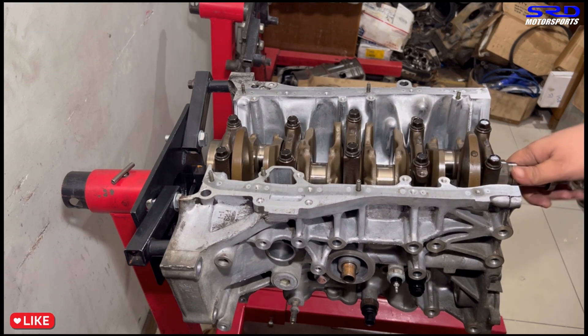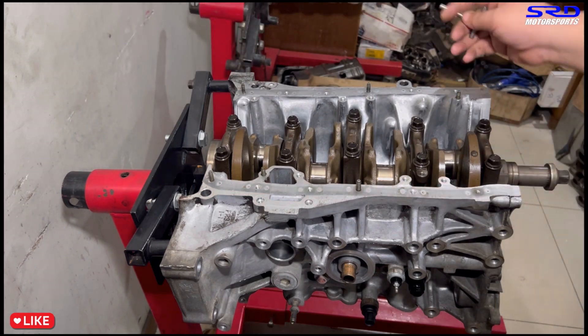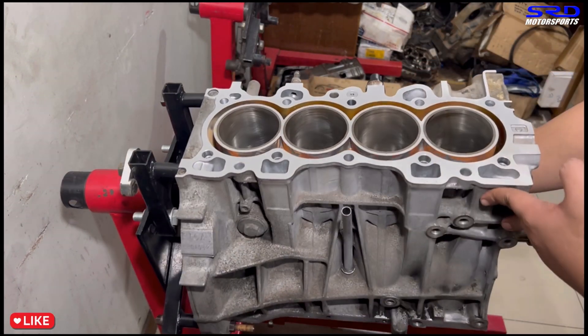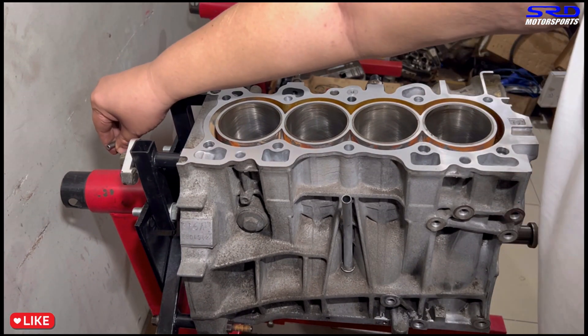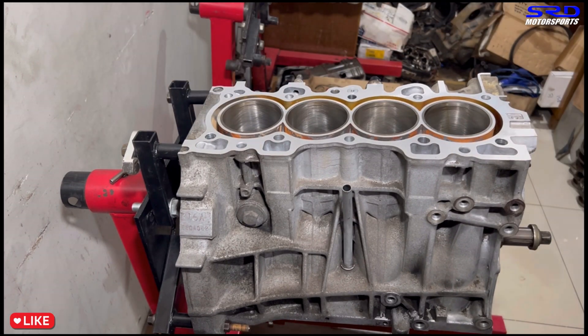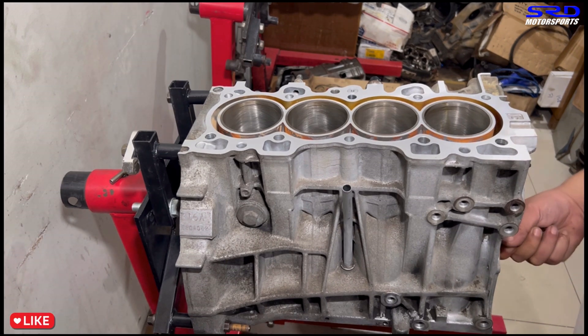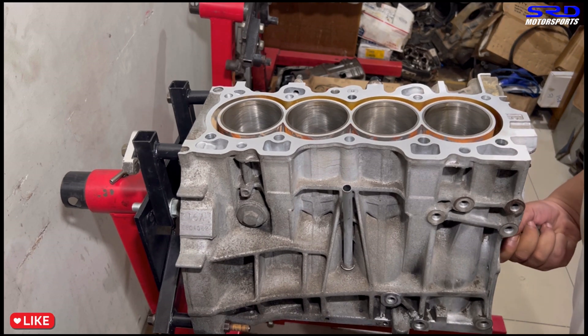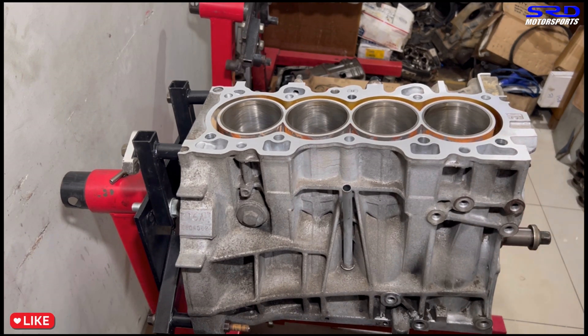It still spins light because the crank is in really good condition — same as when we disassembled it. We turn the block over so the assembly lube doesn't drip onto the bores, as Jay Meager of Real Street Performance suggested. We need to wipe the bores before installing the pistons. As soon as the rods and pistons return from the machine shop and the ring gaps are confirmed good, we can assemble the shortblock.